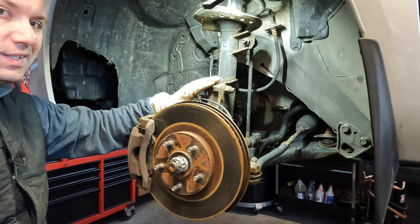We are going to be removing our rearward bushing. This is also an 18 millimeter. What I find is you don't really need to oil this or anything — these usually come off pretty good. I'm going to take an 18 millimeter and put it up top to hold my bolt, and then go ahead and blast it off with our impact gun. I always find this one comes off pretty easy — sometimes it will depending on the level of rust, but for the most part you can just get in there and take it off.